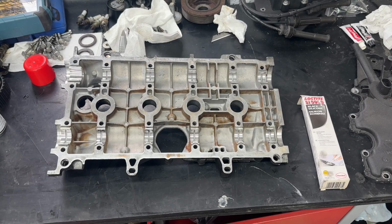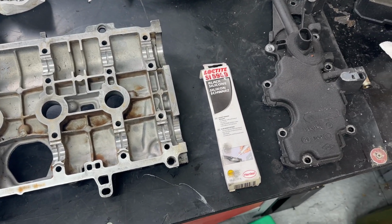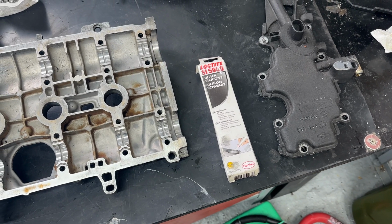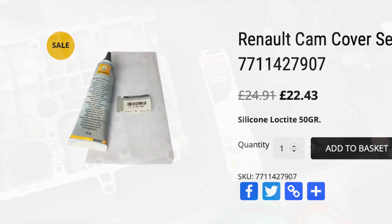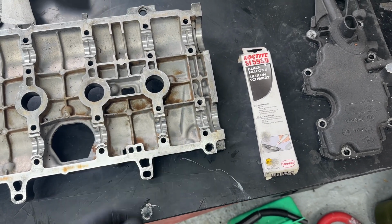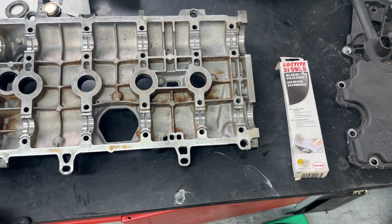With the engine side clean and the rocker cover this side all degreased, we can now look to seal it. Now, Renault do provide a Loctite, I can't remember the code, I'll try and put it in the description if you want to use the original stuff. I've always used this for years. The argument against this obviously is when you put it on, it can squidge out like you've seen, and unfortunately get drawn up into the oil pump and make a mess if you go too heavy-handed with it.